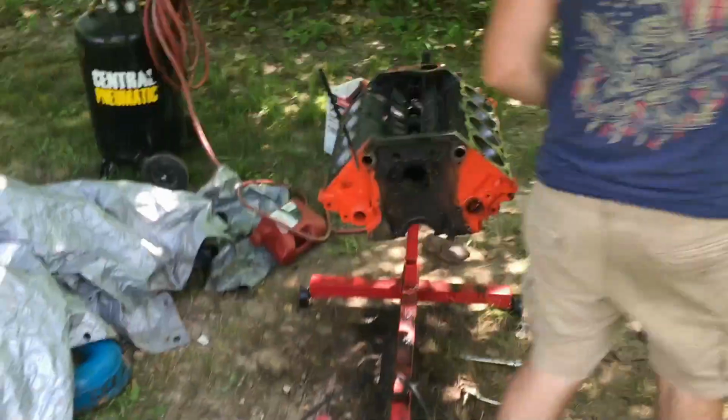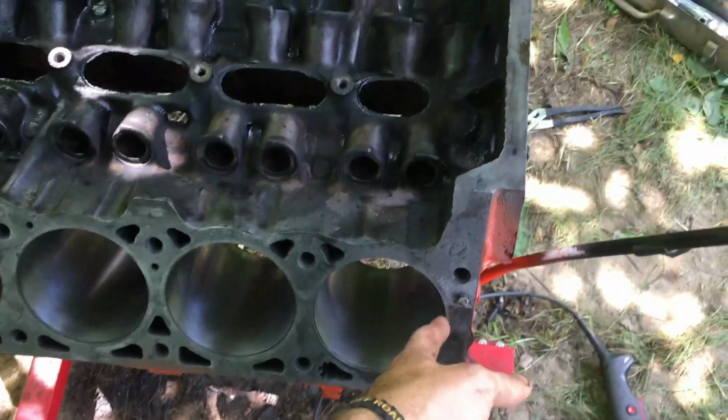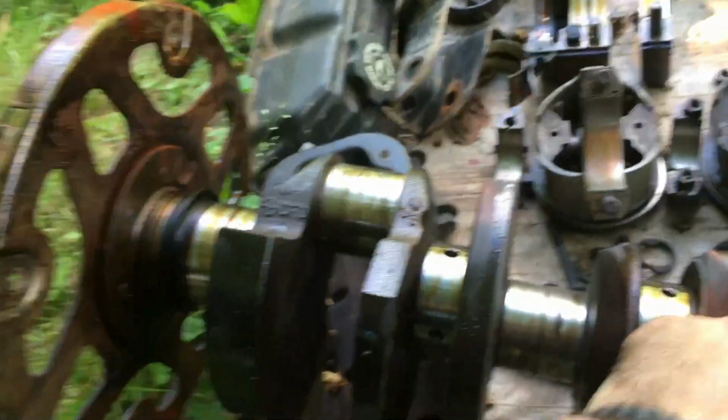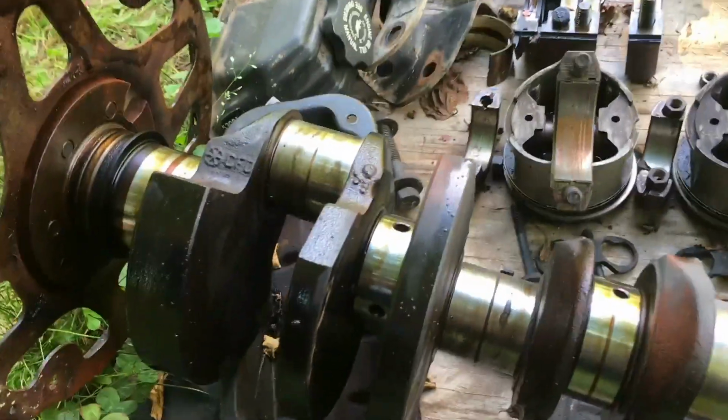All right, guys, picking up kind of where we left off. We were showing you how to do the pistons. You've got your front relief on the front. What you do is take it out, flip it, and put it directly on the other bank, and you'll get a couple horsepower doing it to all of them. But anyway, moving on, we have the crank and the crank bearings out. The crank's fine. There's nothing wrong with it. The bearings had a little bit of filth in them, but we think that was from the cam, which was a little scuffed up.